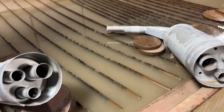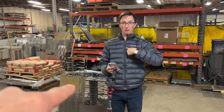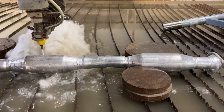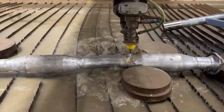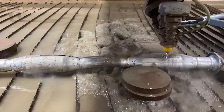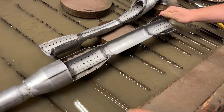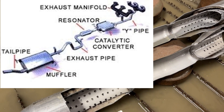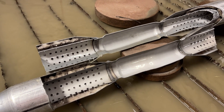So now that we've learned how mufflers work and have seen it for ourselves, let's cut the resonator and see how that differs. It's got a tiny connection there. The resonator just looks a lot like a glass pack — it's just a small glass pack. The resonator typically goes before your muffler. It adjusts the frequency so it doesn't have a drone.